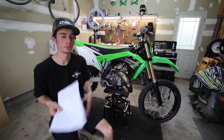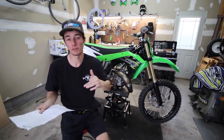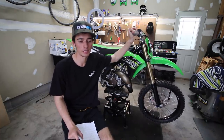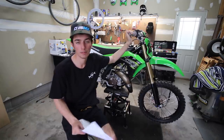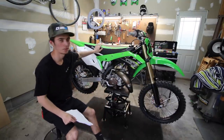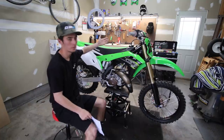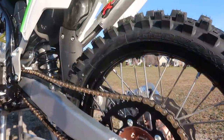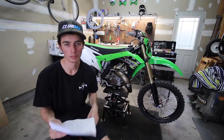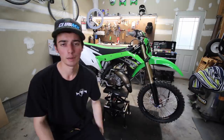Everything is super solid on it right now being pretty much brand new, aside from stuff getting loose — that's just normal. The 125 on the stand side by side is about two inches lower than the 250F, so if you're taller you're a little more scrunched, but you can get taller bars. These are just the stock 2018 250F Renthal 7/8 bars. For the wheels: no issues, just check the spokes, tighten them up evenly so you don't warp the wheel. Check them after the first and second ride. The sprocket that came on it probably won't last too long, but it'll have to get changed at some point.